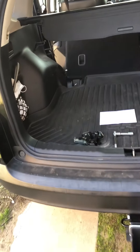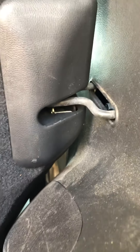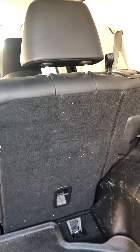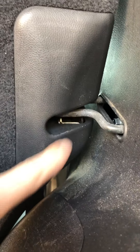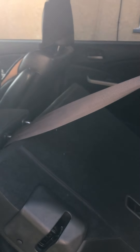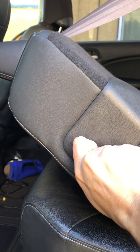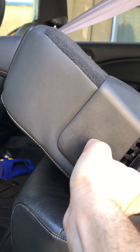This is the new part that I got. As you can see, the issue is right here — where the lock gets stuck. That little hook gets stuck onto this latch. You can just use a screwdriver to pry it off. I believe this side is stuck too. There's a little hook that goes in there — you kind of just dig your screwdriver in and pop it off. I already got it started; I put the seat down and these just basically pop off.